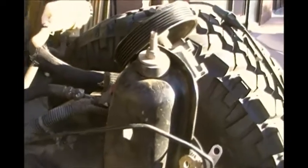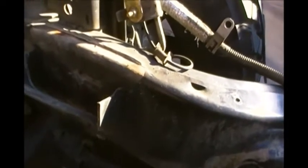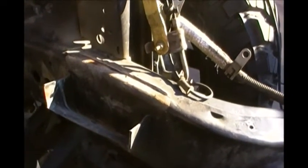Be careful when you cut these motor mounts off. This brake line can easily get damaged if you have a cutting wheel. There are various ways you can remove these engine mounts. My preferred way is to score the weld and then with a heavy hammer give it a smack, and they usually pop off.